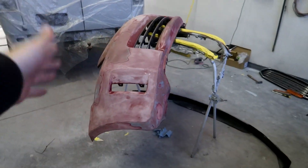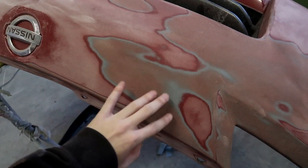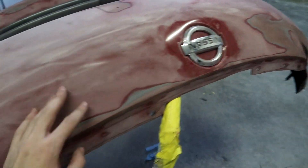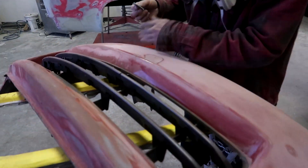After seriously going at it for like an hour, we've pretty much sanded the entire thing. This gray color is pretty much down to the plastic, and then I obviously need to hand sand around some of this. But we're going to hit it with a scotch pad right now to get the last of this clear coat that I missed, and then we'll prime it.